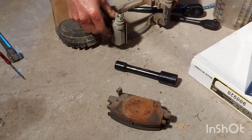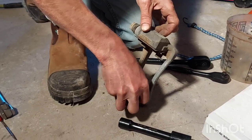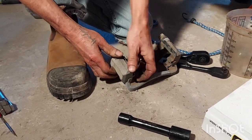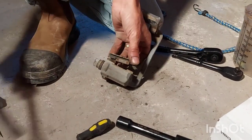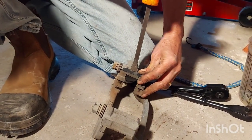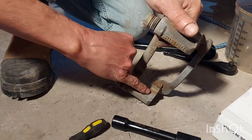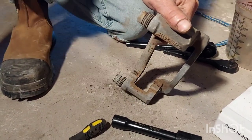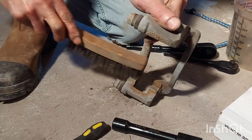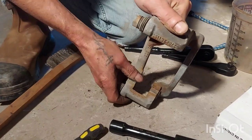We're going to take our spring clip out, start at the bottom there. Same on the back — slide them out. They're a little sticky, just get more twist with a bar. Now we're going to go ahead and clean in here and put a little brake lube in there. Get any rust out of there before we go any further. Get your wire brush — you can use a wire wheel — and get any corrosion out of there, just like that. Nice and clean.